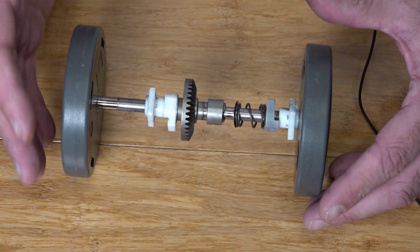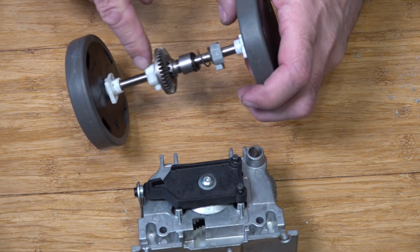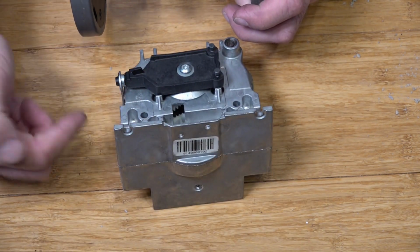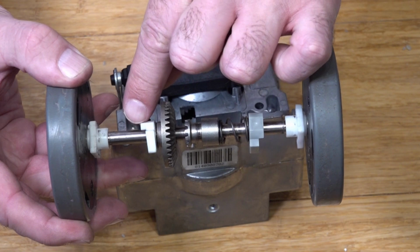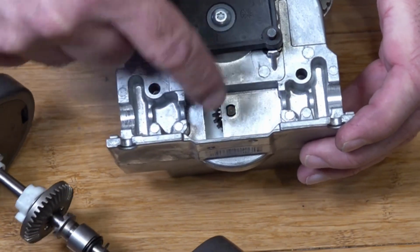And then we'll slot this back in the tech drive. Now to slot the axle back in, you've got to make sure you've got the top. So these are the top. The smaller part of that is the top, which will face the top of this. So the smallest face is the top, a bit like a pyramid. These are going to face out, like so. And these are going to slot in here either side.